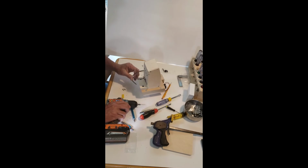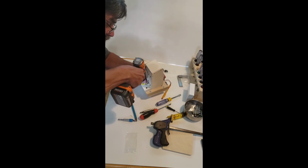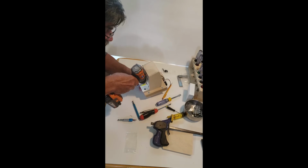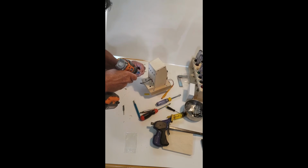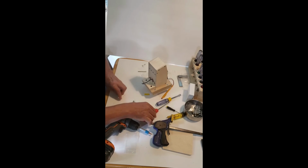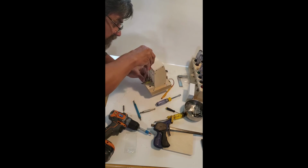I have a slightly smaller drill bit here. It's like 16th. So what I'll do is we want it somewhere in this general area. I'll put one hole in it. Then I'm going to line it up and put the other hole in. These are a little bit small, they're a little tricky to work with. Now I got them threaded. Should be a little bit easier. This is not magnetic. How about this? Now this is even chamfered, so note that. Chamfered for the screw.